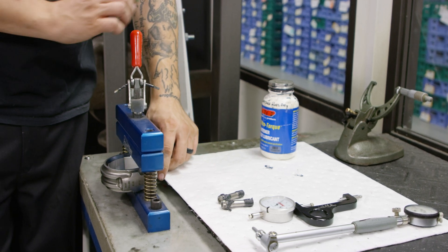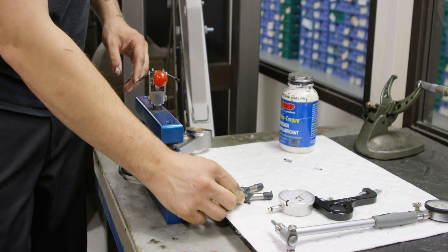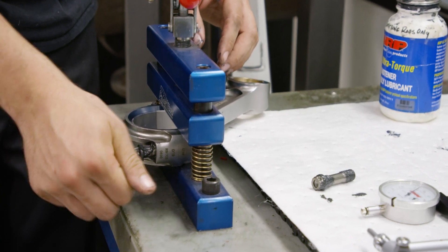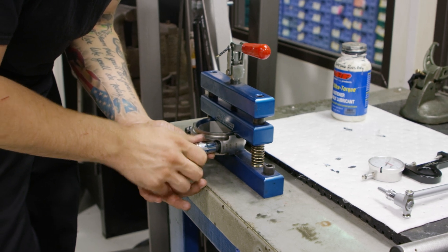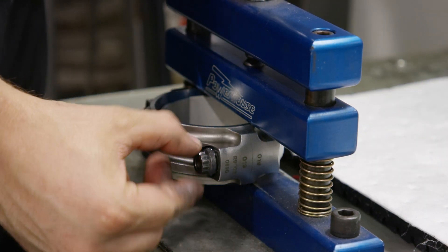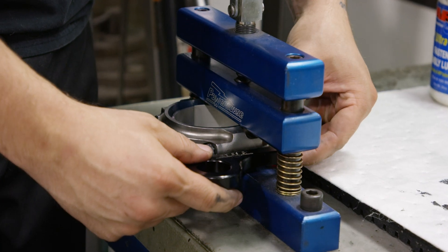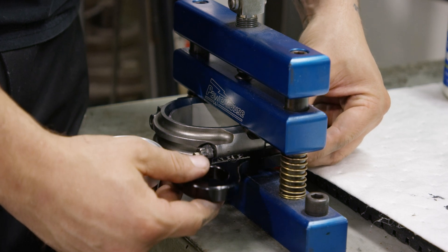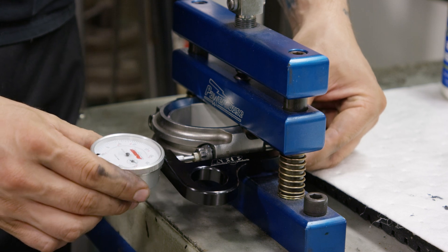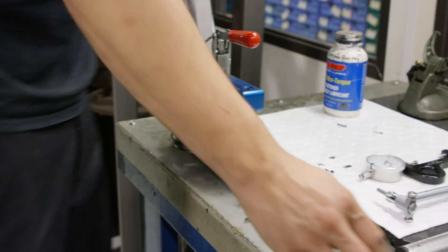After the bolts are lubricated, clamp the rod in a rod vise, insert the bolts and thread them in by hand but do not tighten them. We want an unstretched length so that the stretch gauge can be mounted and zeroed before torquing. Note that Cummins connecting rods have only one rod bolt with access to both ends, so a stretch gauge can be used just on this bolt. Mount the ARP stretch gauge to the bolt, zero the gauge — this will be your unstretched reference length. The bolts can now be torqued to the 135 foot-pound torque spec found on the tech card in the Boostline package.